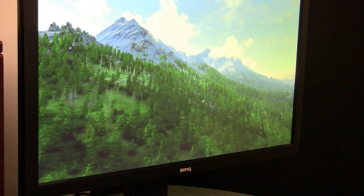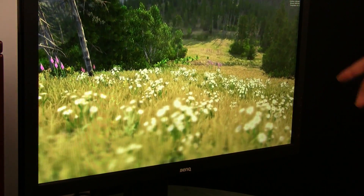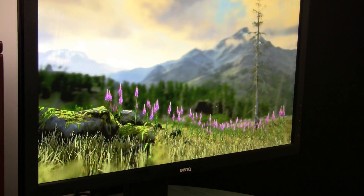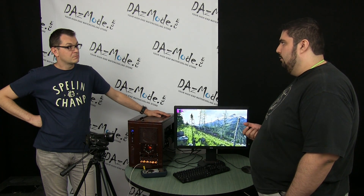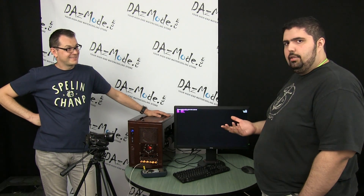What you're looking at right now is Unigine Valley running. It doesn't look really great on camera because of reflections, but it's just running as a stress test. It's been running for about 20 minutes. You can see the temperatures hovering around 40°C, and I also have the MSI Afterburner overlay over there. Around 40°C is perfect for GPU temperature with such a small water loop. Daz was telling me you did just a spread method — that's what I also recommend for GPUs. Spread always works. The mounting pressure of a water block on the GPU is totally different than a CPU block, so always go with the spread on the GPU and a blob on the CPU.